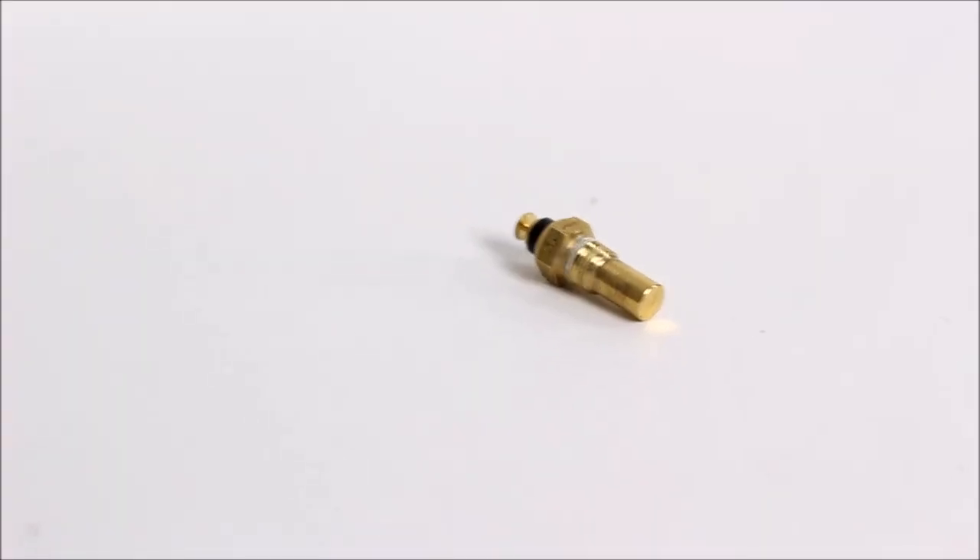For now, the main reason I got this was to run a couple of sensors. In the first port I'll be running an oil temperature sensor. Here's a little lesson — Snapple fact of the day — your oil actually comes up to operating temperature much slower than your water. Most people think that once your water temperature gauge is in the middle you're good to beat on your car, but that's not true. On the Miata, the water temperature at that point is really only about 150 degrees, when operating temperature is 195. And when the water comes up to operating temperature, the oil can still take several minutes after that to reach its operating temperature.